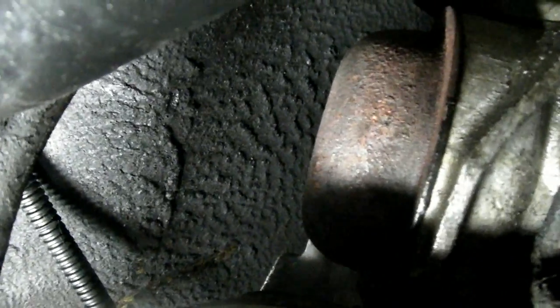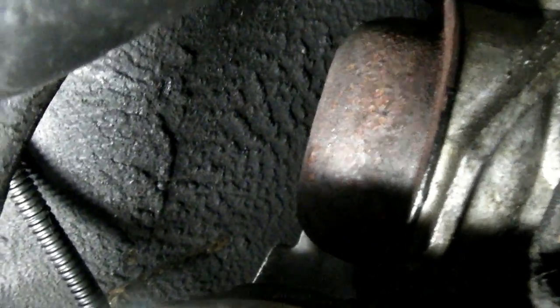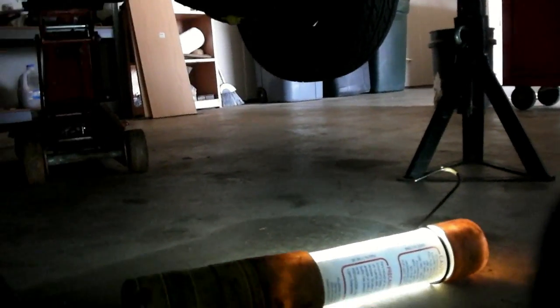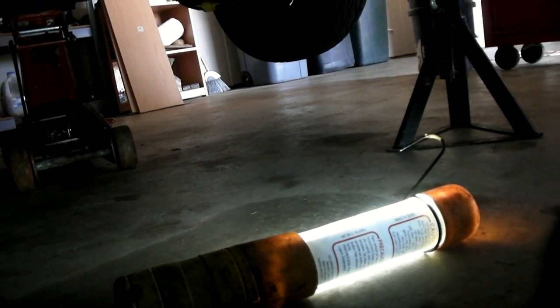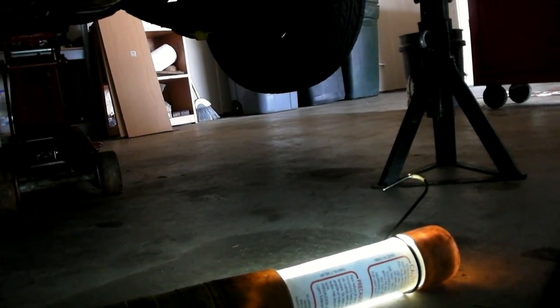Some of them have a clip on it, some don't. This one's just pressed in — no clip — it's a '92 Camaro transmission. So you want to pop that off with a screwdriver. Your governor will be right under there. You're going to want to get a pan and possibly some cardboard to put down to catch any transmission fluid that leaks out. Not much will leak out — maybe half a cup.